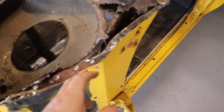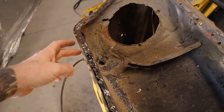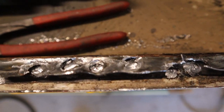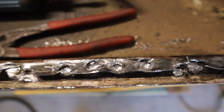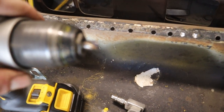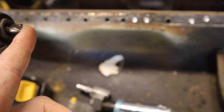I've just started up here and been working my way along - I'm up to this mark here. This section is actually a bit of a bitch because you've just got so many spot welds and they're so close together. You can just see here there's four spot welds there that are literally within 10 millimeters of each other. I've just been using this spot weld drill bit - it's flat and it's got like a little point.